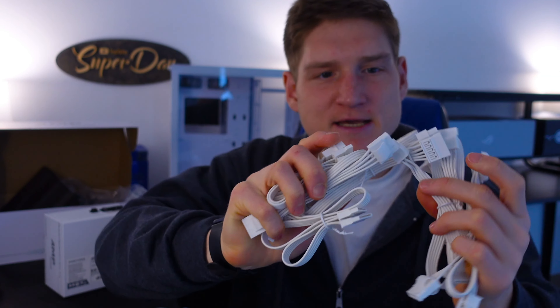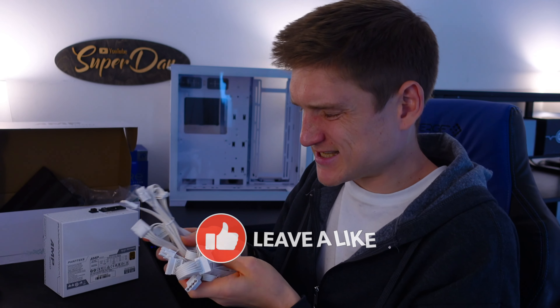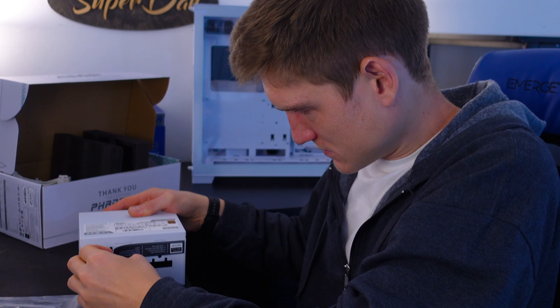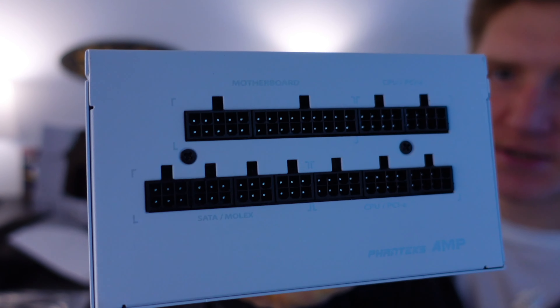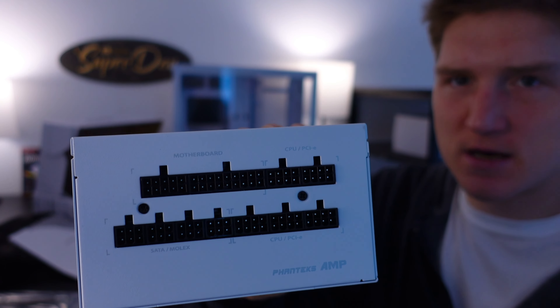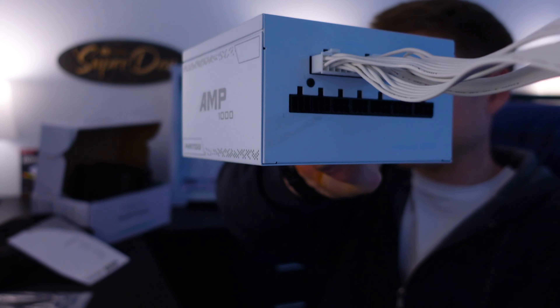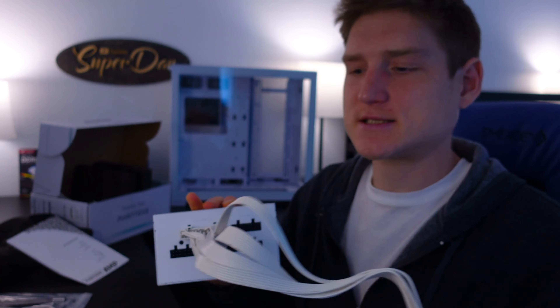It's not the hardest thing to do. These are not the threaded type of wires, they're plastic. And I'll be really honest, they look like a bit of a warm white — a much warmer kind of white. Probably should remove that sticker. So even if you don't get this power supply, it's pretty much always going to be the same. You see how these have clips on them, and then you also see the upper slots on the actual power supply — it labels it right on the power supply for you. Not every power supply is going to do that, but it's one of the benefits of buying something that's a little bit higher quality, especially for somebody that is a beginner trying to build their computer for the very first time.